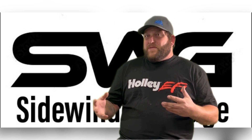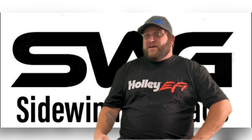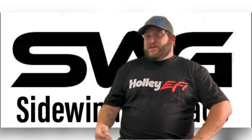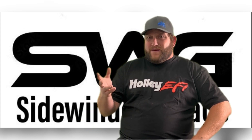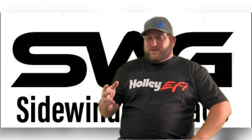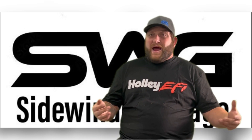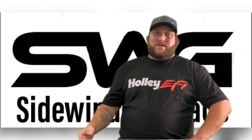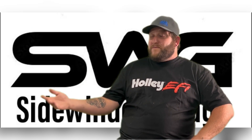This is what most of your swaps out there are going to be. I know nobody wants the smaller 4.8, but the price difference means you're not giving up very much power compared to the 5.3. The 4.8 horsepower rating was between 270 and 290 horsepower and 285 to 300 foot-pounds of torque. The 5.3 came in at 270 to about 315 on the torque — that's not a big difference when you're picking it up for almost half the price. Now telling a 4.8 from a 5.3 might be difficult. First thing you can look at is behind the water pump — I'll put a picture up — there will be casting marks and sometimes a paint mark. It'll say 4.8 or 5.3.